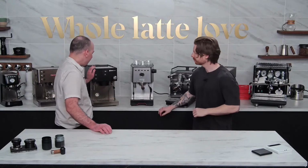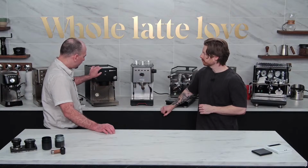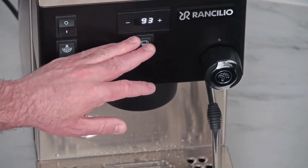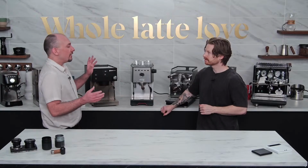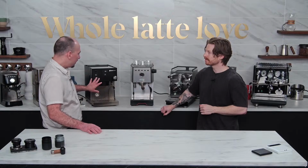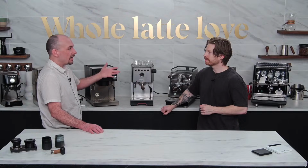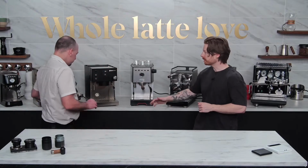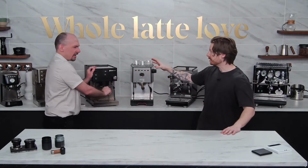Yeah. But not really too much else to say about it on the Rancilio. My opinion, honestly, is that for most cases I would leave it at 4 and above in terms of duration, because when you're around 2 or 3, in some cases very little water will actually leave the group. And it can be inconsistent, because you may not have water that's already ready to start flowing, right? Exactly. So we can see the natural difference in flows between each one of these.